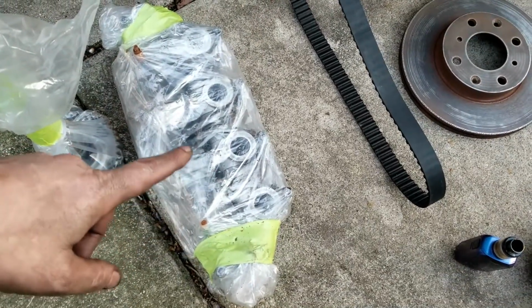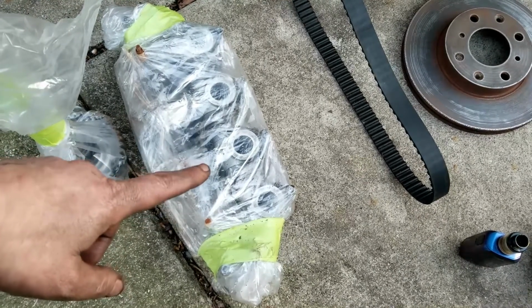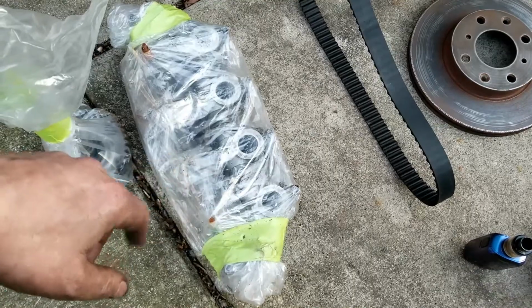I still need to get the rotor on the passenger side, get that cleaned up, and then that C-clip on the ball joint, the lower ball joint, needs to be put on. The radiator, the two coolers, the transmission and the power steering cooler. I'll have to put the power steering pump back on. Of course, the exhaust manifold. But I mean, most of it's done. Well, I need to get the rest of the head put back together, and so that's kind of important. And then obviously I'm going to have to do the valve adjustment.